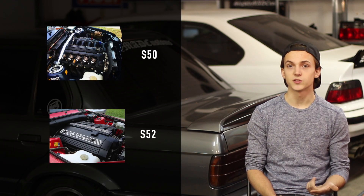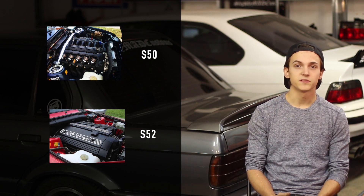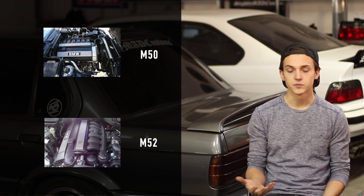Ideally, it would be really awesome if you could find an S50 or S52, although they are quite expensive and hard to come by. So more realistically, we're going to be looking at M50 or M52. My largest concern with the M52 is the amount of coding you'll need to remove the EWS immobilizer and all of the emissions-related programs with that engine, whereas with the M50, it's pre-emissions, so it's mostly just bolt in and get the engine started.